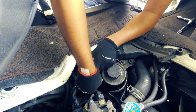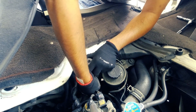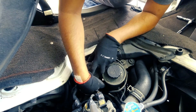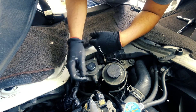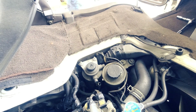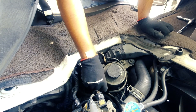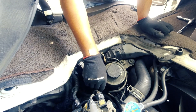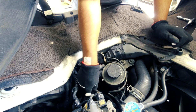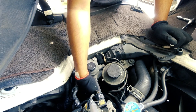I can undo this one properly now — all the way off. Remember, there's air pressure in the system, so you want to be a little bit cautious. It might pay to put a bolt or a nut or something in there, which I think I might do. These little plastic furniture screws — just bung that in there for now. Just remember not to twist them too much, otherwise you'll end up snapping plastic off into your fuel lines. Not fun. Your injector pump will not enjoy that.